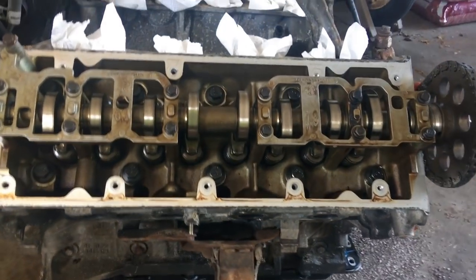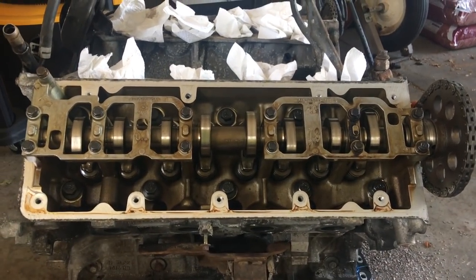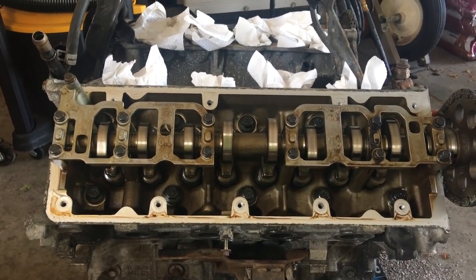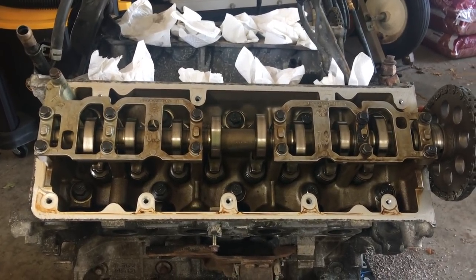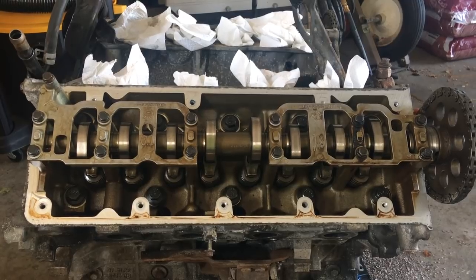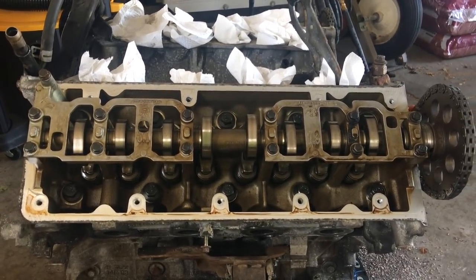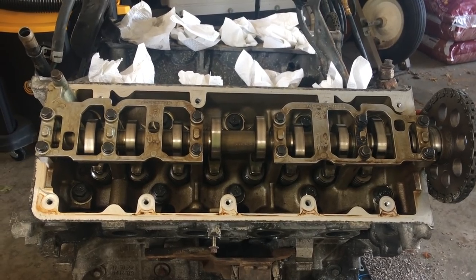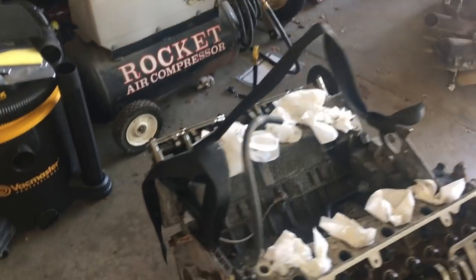Another key difference that I didn't mention earlier is that these valve covers here, I think it's 11 bolt on the Romeo, where the Windsor had a 13 bolt. Now we're just going to use the valve covers from the Mountaineer. The oil filler tube is going to fit perfectly where we need it to. And we're just going to go ahead and use the Romeo valve covers. And they're also the same depth and height and everything like that, so they'll fit just fine.